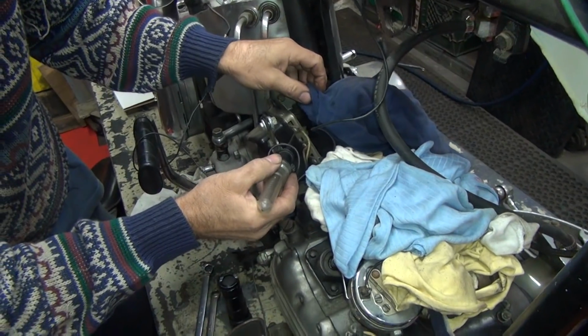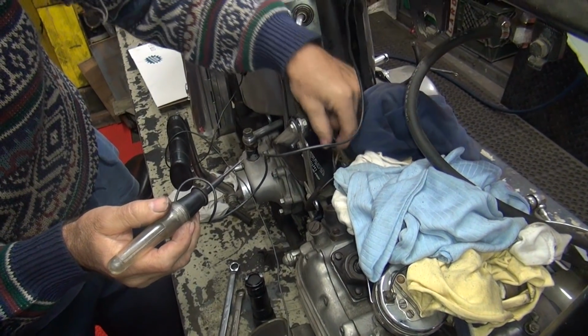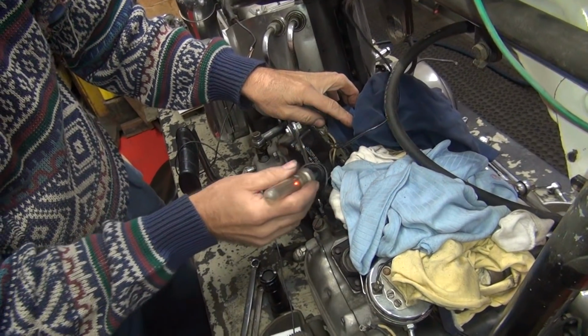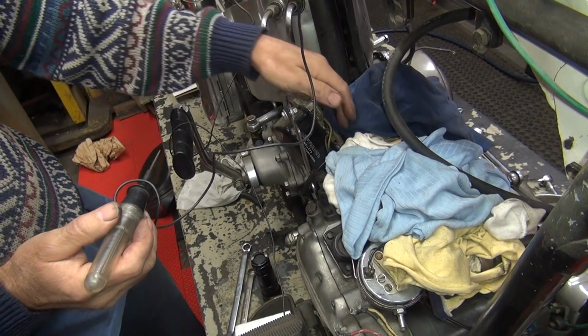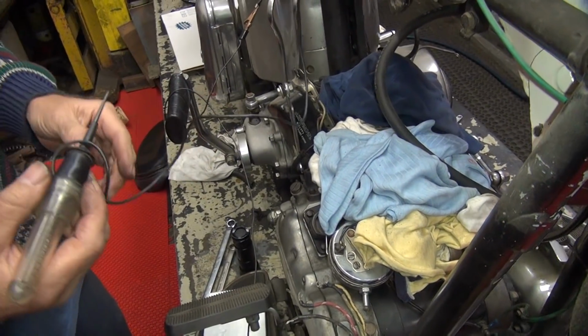One of these should be hot. Oh, hot. Okay. The green is field and red is armature, so that's connected. And that's a full-time hot. See, the switch is off up here. This is a full-time hot because it goes right to the battery, because you don't want the generator going through your electrical circuit. You want to go right out of the regulator, right to the battery. Okay. So no, that breaks the circuit. No stops, no errors, it goes.